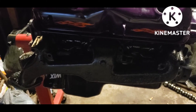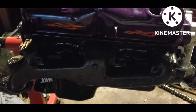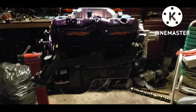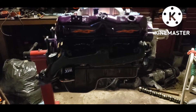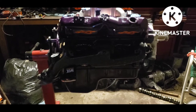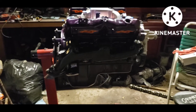The reason I haven't shown degreeing the cam yet is that it does not have a Woodruff key in the cam. It's been so long since I put one in, and I don't have any brass hammers or brass punches to put it in. I don't want to screw the cam up — don't want to hit it with a steel hammer or press it in with vice grips.